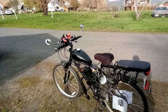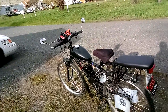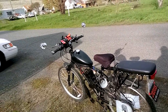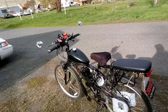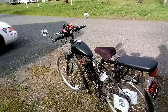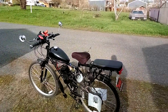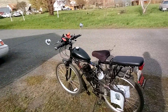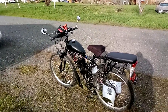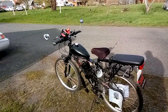It's just mistakes that I had to learn from, and you guys hopefully won't have to because you'll be able to watch the videos. Motor mounts actually broke and I had to fix that. That's something that BikeBerry is taking care of — they say they're doing 8mm studs on all their two-cycle engines now, so that's no longer supposed to be a problem. Make sure you check with them on that.